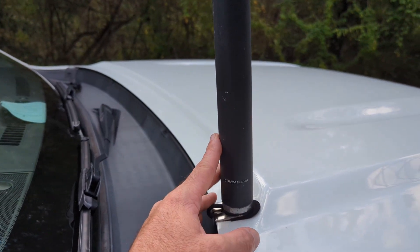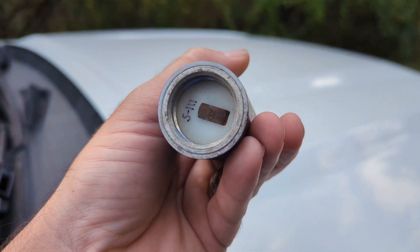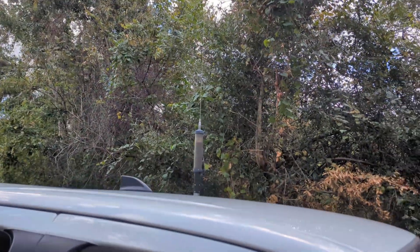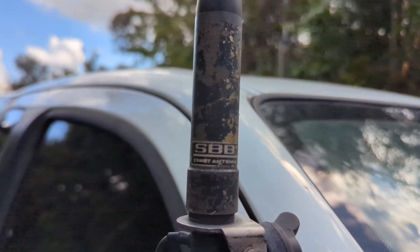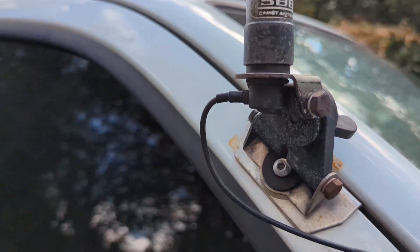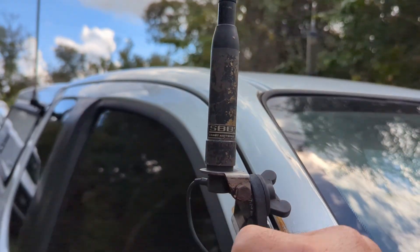I've got one of these going on my tower with a ground plane kit for local vertical communications — that's also Compact Tenna. After all these miles and a couple of years, it's looking good. The mount is old but it's working. It pays to have good mounts and good antennas. That is a Comet mount — it's old — but this antenna, the SBB7, has three-quarters of a million miles on it. I know that from the mileage of each work vehicle, usually 200,000 miles each. This antenna is still 1.1 to 1 VSWR — no problem at all with the Comet mount or the Comet antennas.